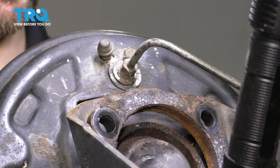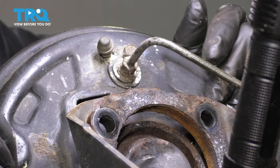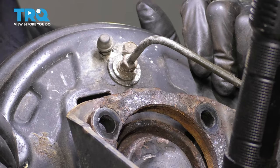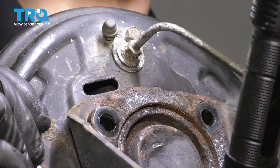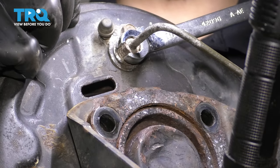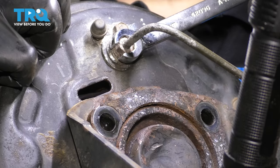Since everything is separating, we're going to have to remove this whole assembly off of here and get it out that way. The first thing holding us up is going to be this brake line, unfortunately. So we have to break it free, whether it's here or at the brake hose further off the line. I'm going to try over here — try to set this back in temporarily and get a 10-millimeter wrench to break this free. What you're looking for is the fitting to break free without spinning the line as well.